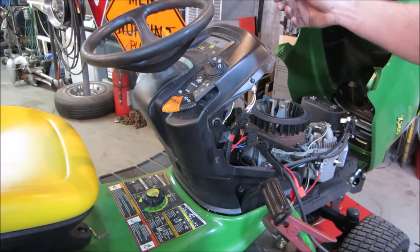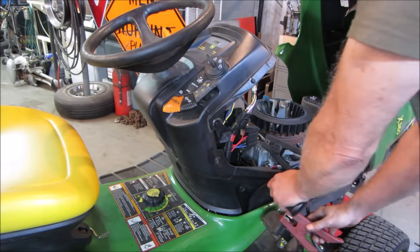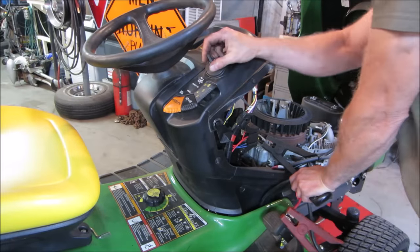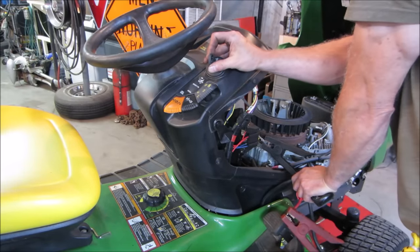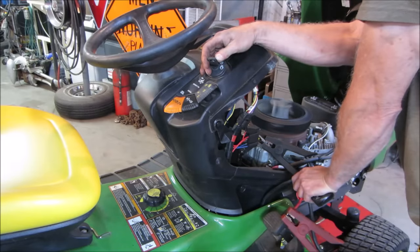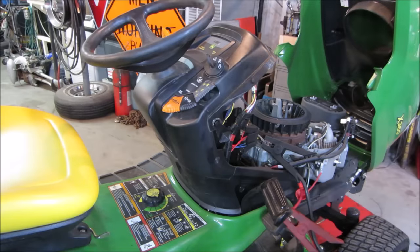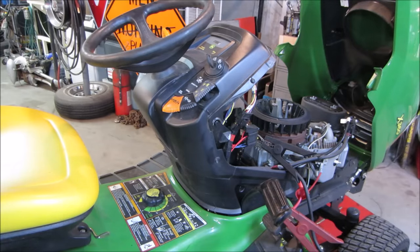I don't think it's gonna crank. I think we might have to be on the seat or push a pedal down or both. Let's go. I got the other coil wire disconnected. This one, see if it's gonna crank for us. Yes, let's listen to it. Starter sounds horrible. Let's go get our other new coil. We'll pop that on there, see if we got spark and see if she'll fire up with a little dribble of fuel down inside it. Plus she just fires right up and runs perfect.